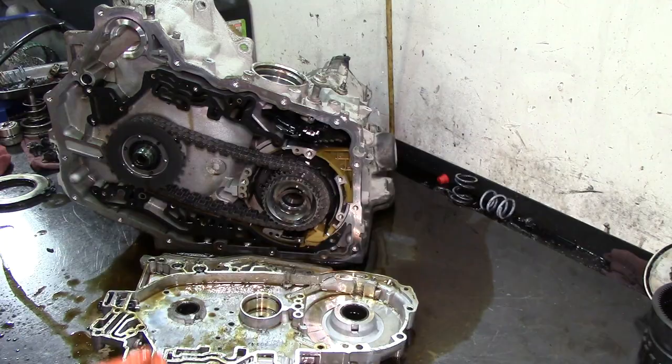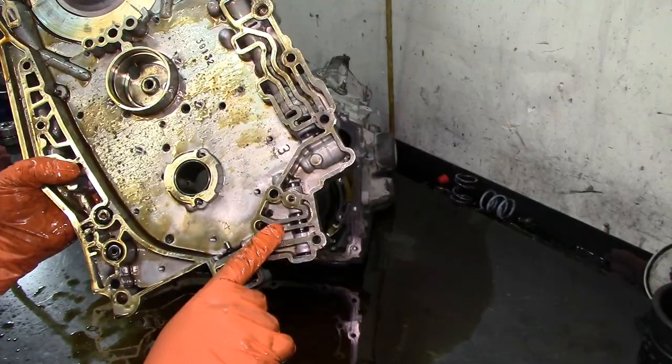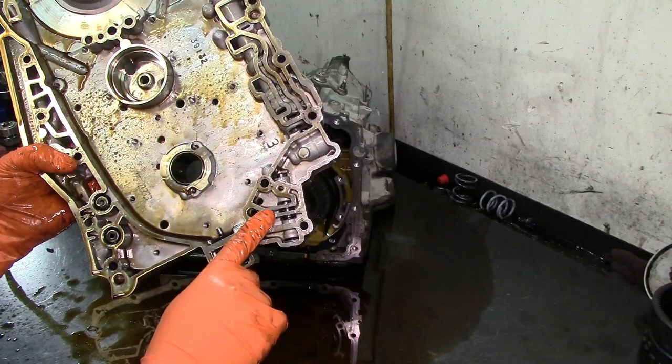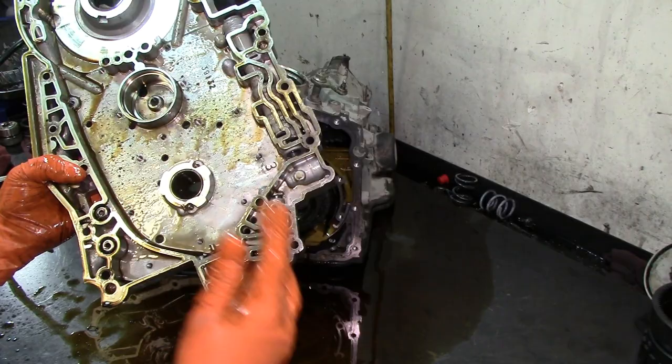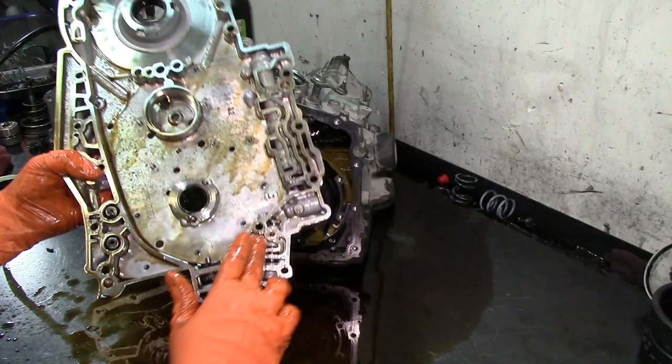Turbine speed sensor. And we have a valve here, which is very, very critical. Trouble code P1811, transmission adapts, maximum shift. I can't remember exactly what the name of it is. It detects excessive apply time. And on the actuators are the solenoids. You've got the pressure control solenoid. This valve wears out. There's an updated valve, and we're going to put an updated valve here. Actuator feed limit valve.